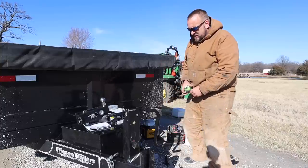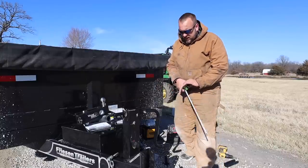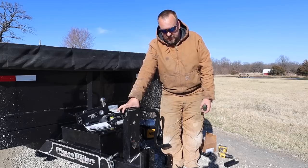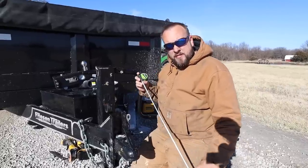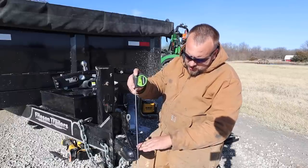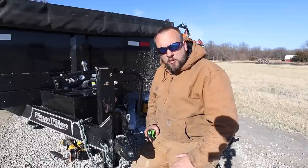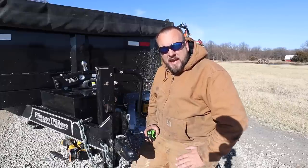As I measure it and try to get it leveled out, it makes me think about all the times I didn't feel safe towing — I realize I've never run this thing anywhere close to level. It's always been at least 8 inches higher in the front than the back and I just didn't realize it. The next step is determining how high we want to set the ball on the truck. You're going to measure from the ground to the top of the hitch — we've got 16 inches here. For my setup at 1,400 pounds, I need to be about 2 inches higher, so the top of my ball needs to be at 18 inches.